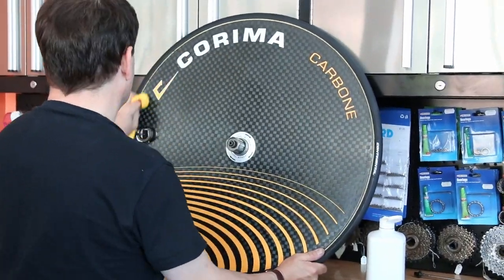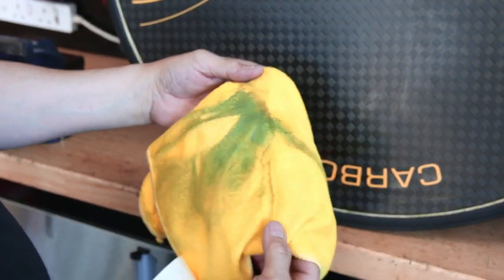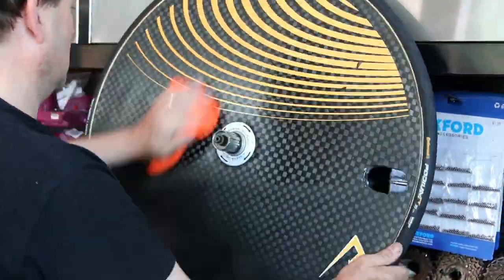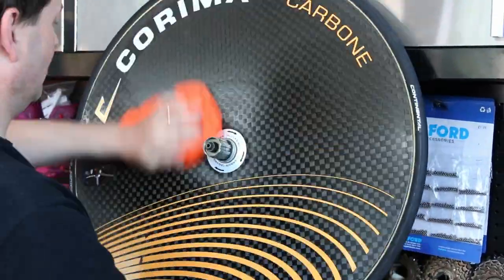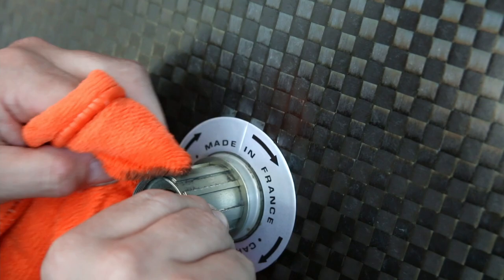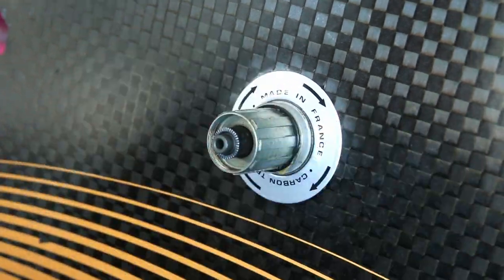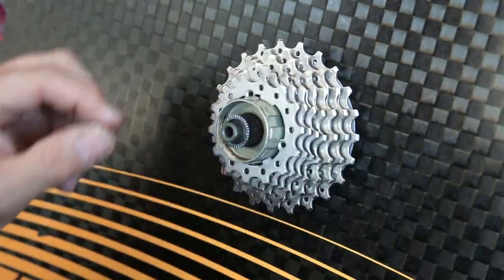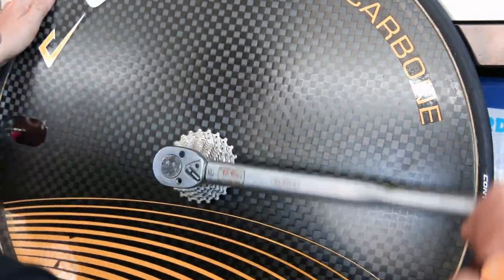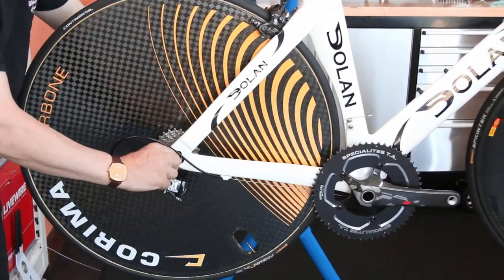Now I give this disc a little cleanup — you can see we're using the Auto Glym resin polish. That's the road film coming off; you can see it needed a clean. The braking surfaces get that road film and grease too, so just make sure your brakes are working nicely. We also give the freehub a little cleanup before we put the cassette back on — a little bit of grease on there just to stop the cassette sticking, just a small smear. Then on goes the cassette lockring, torqued up. Everything's got to be done to its torque spec. The wheel goes in and we just check that everything's okay.